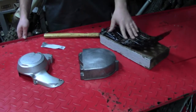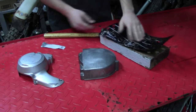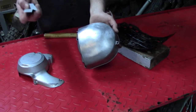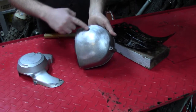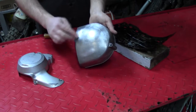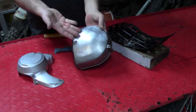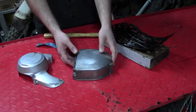Here's a closer-up shot of the skid plate — it's kind of beat up. And this ignition cover: I've already done a little bit of prep work. There are some light gouges, and what I did was take some 80-grit sandpaper just to knock down the rough spots and the high spots where this bike fell over and hit a rock or something. These old bikes have aluminum side covers that are cast, and they're kind of a cheap casting — they're real soft, so they're easy to damage.